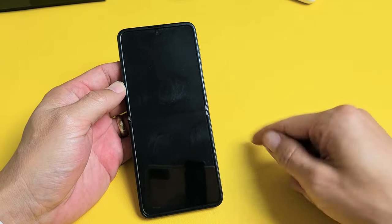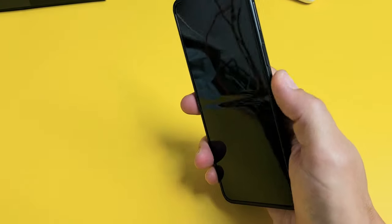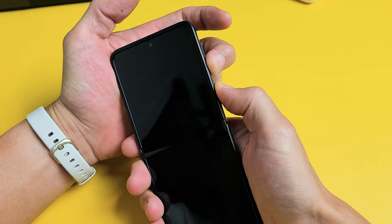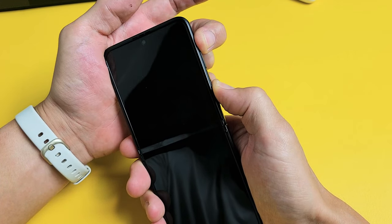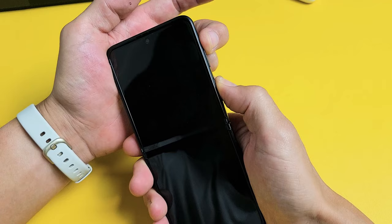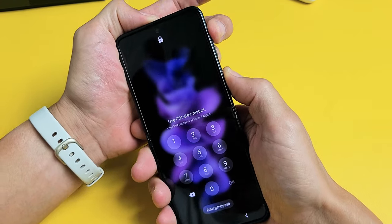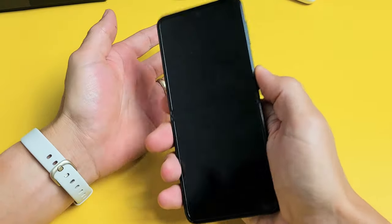If you're still down, the next thing is wiping the cache partition. Some of you guys may or may not be able to do this, so watch closely. Hold down the volume down and power button together, press and hold both for 15 seconds. After 15 seconds, let go of only the volume down and press and hold the volume up — never take your finger off the power button. Once your finger is on volume up, as soon as the Samsung logo appears, let go. That will boot us into the Android recovery menu, and from there we can wipe the cache partition.